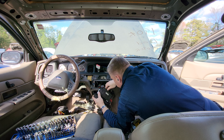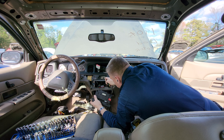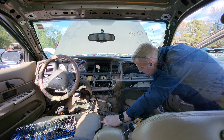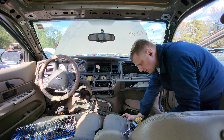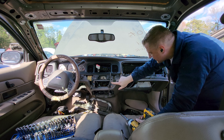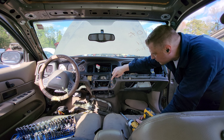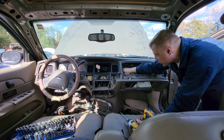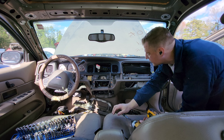This has been replaced before because this is a Dorman module, not a Ford module. This right here is still a 7mm — it just looks different. This is what holds the hose for the interior temperature sensor, which is part of the automatic climate control. If you don't have automatic climate control, this white hose won't be here.